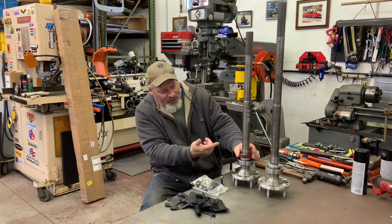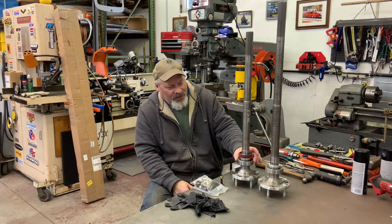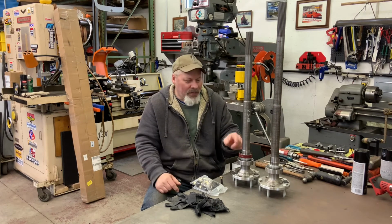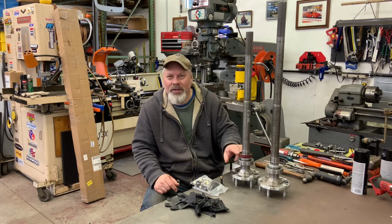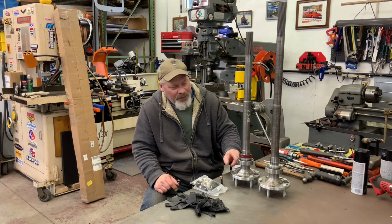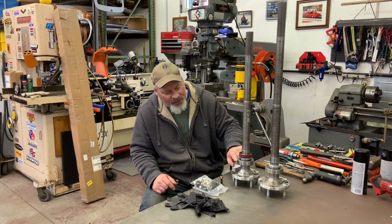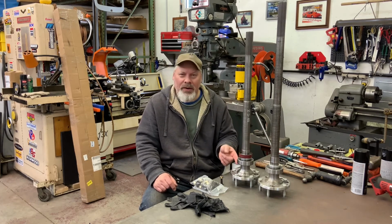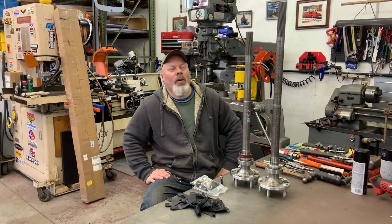The seals are on one axle. It's the type that takes the inner seal in the weld-on housing end, so I have to make sure I have the correct housing end to take the seal. I have two sets. Hopefully one of them has the receiver for the seal, because the bearing itself does not have an O-ring on it. So the seal does all the sealing, plus it's a sealed bearing. Either way, I'll make it work.